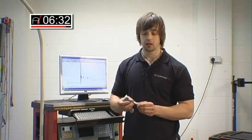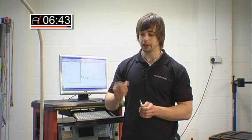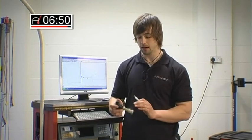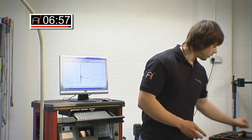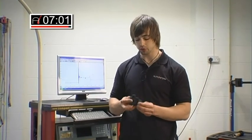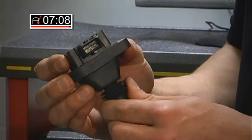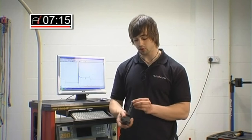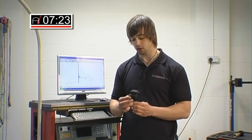Dead easy to check. It's also worth noting that before jumping to conclusions and changing the coil, a lot of times we try to wash the coil out — cleaning all inside the rocker cover where the insulator goes, cleaning the insulator with some TFR, then washing it down with lukewarm water. Bear in mind these coils, although they look rather sealed, are not actually watertight in most cases, and we have seen cases where washing them made things worse. But if you take great care, we have had a lot of success washing the coil, drying it out fully, and the signal improved significantly. So it's worth trying before condemning the coil as faulty.